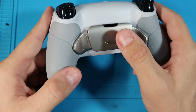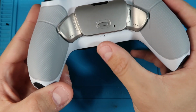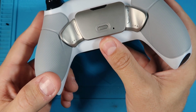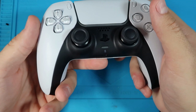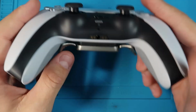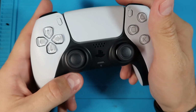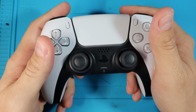The old touch capacitive buttons were terrible, to be honest. It used to be down here and you just held it with your thumb or finger to activate program mode. The problem is when you're holding the controller, sometimes your finger would kind of rest on it, or if you rested it down your leg. And when the controller is in programming mode, the paddles do not work. So if you accidentally go into programming mode and you're trying to use the paddles, they're not going to work.